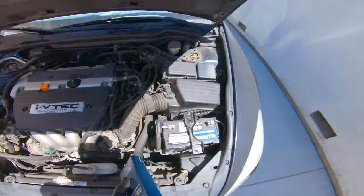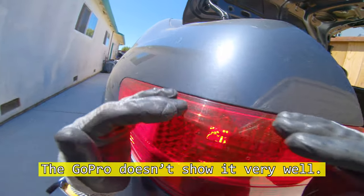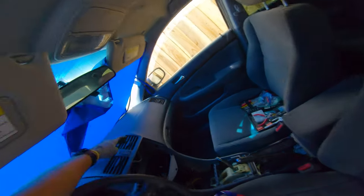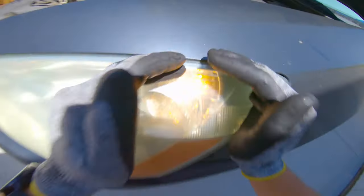It's pretty bright. I want to see what it looks like in the housing during the day — just pop it in there quickly. Hard to see, but it seems bright; we'll have to check it at night. Turn signals — nice and bright. Confirm the other one — looks good. Hazards — let's put those on. Looks good, those are working. Next step: replace these and the reverse lights, because the reverse lights need to be converted, but we don't know if we need resistors yet.